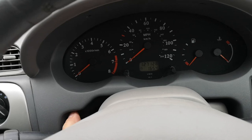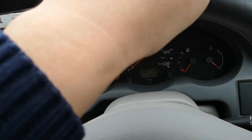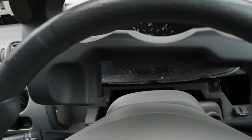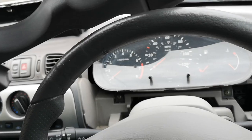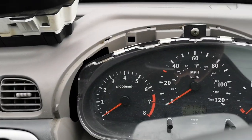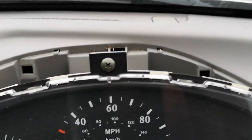Incidentally, it helps if you've got the steering wheel a bit lower. The cluster itself or the binnacle itself just pulls off like so, and you are greeted by the cluster itself which is held in by one, two and three crosshead screws.